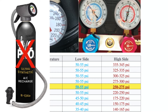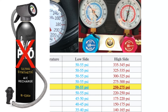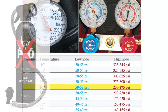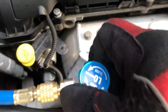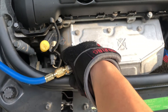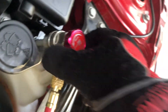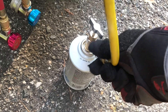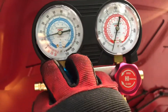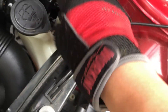For safety, your compressor will be turned off, which means you won't get cold air. So I stopped adding Freon gas and left it as is. Once done, close the knob on the Freon gas can and close the lower side and high side couplers. Now you can take off the coupler of the lower side as well as the high side — for the high side, just a little bit. The refrigerant might pop up, so don't freak out. Unplug the yellow hose from the refrigerant can and open the two valves on the pressure gauge to release the Freon gas inside the hose. Don't forget to close the cap for the lower side as well as the high side valve.